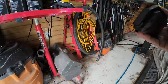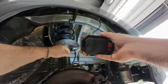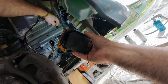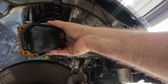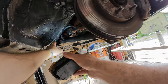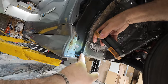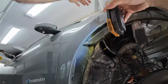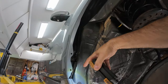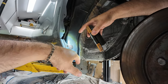There are lots of little channels. This looks like it's just metal on the outside, but if you look more carefully, it's actually a structural member. You should run tools through this to treat it on the inside. You can see there's a seam right here — these are all areas that will rust. This is another area of interest — if you have leaves coming down on top of the car, they end up making their way down and sitting right here. This area will eventually rust out because the leaves really can't escape.